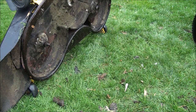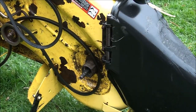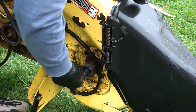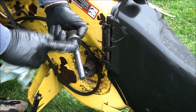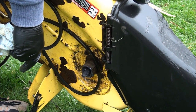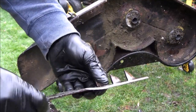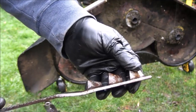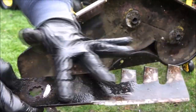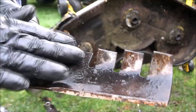Move around to the front and get some grease to put in there. You can fill them up with grease if you want, but I don't think they need that much. Bearing stayed in place — that's good. Lube up the shaft here. These blades were in pretty good shape. I put a little sharpen on them but they were out overnight, so they've already gotten rusty — but that's alright, they're still sharp. You can see which way the slant goes and the fins here — that's the side you want up. Not the bottom side, but the side that has the edge on it.